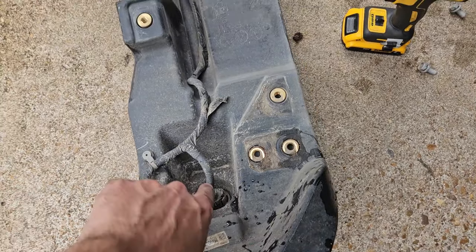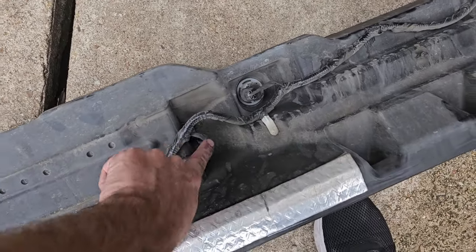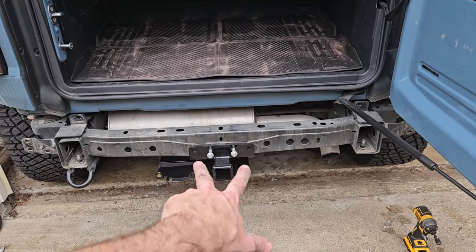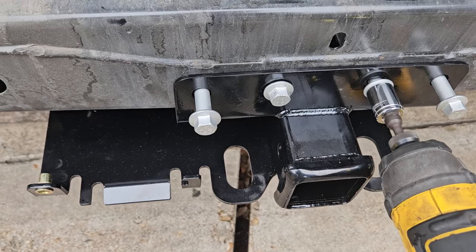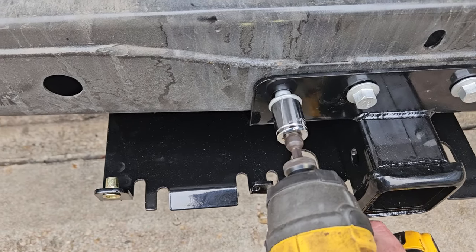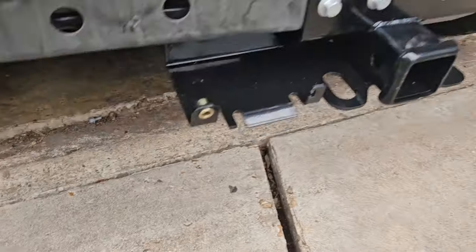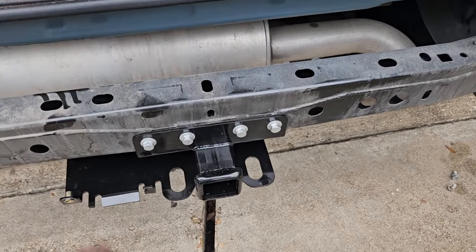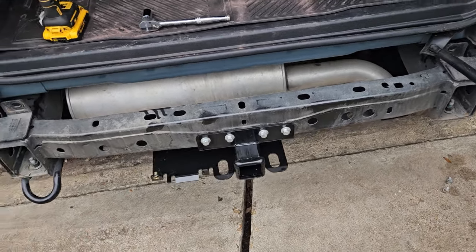These go to the sensors — sensor, sensor, sensor, sensor — and then one that goes to the license plate light. Not sure why they put them on both sides. But now you've got really good access to bolt these down nice and tight. These are also 15-millimeter. Don't just use your impact gun — use it with impact, but then finish with a ratchet or, even better, a torque wrench. These need to be torqued down to about 80 foot-pounds — super tight.